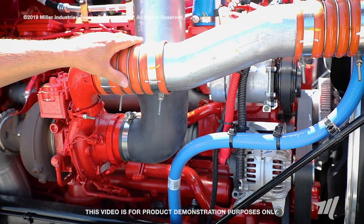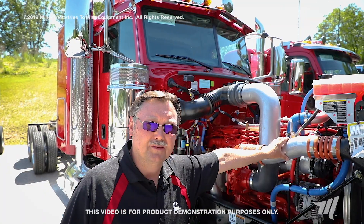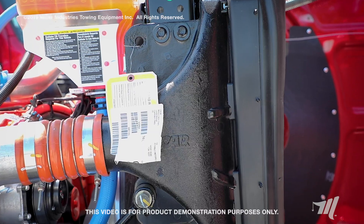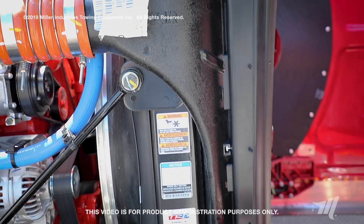Make sure the clamps are tight, inspect the hoses, inspect the mandrel bent tubing for evidence of damage, inspect this hose, and inspect the intake to the charge air cooler for evidence of damage, cracks, corrosion, etc.